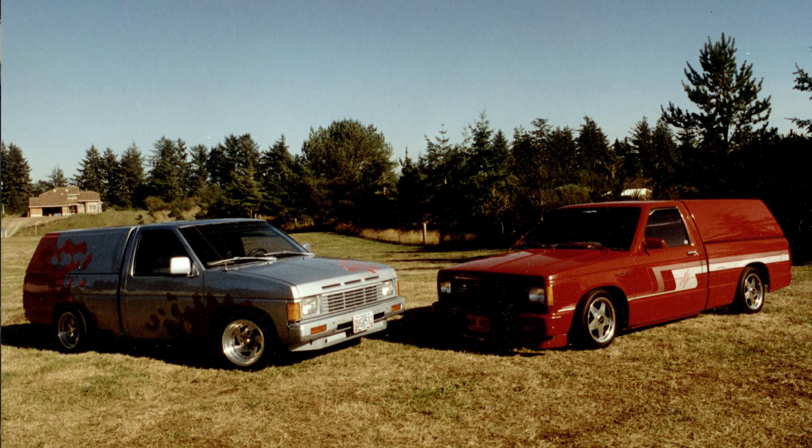Here's how the original door handle looked. They started using these door handles in 1970 — they're kind of ugly, they're chrome, they stick out. So I decided to do something like this: you just put your finger, press on the rear, and the door swings right open. It operates well and there's no issue with dead batteries or being locked out. All I had to do was get a stainless steel pocket, figure out the door latch mechanism, weld it all together, and weld the door handle inside the door. They turned out really well — I came up with a shaved door handle look without any of the shaved door handle problems.